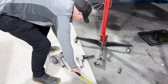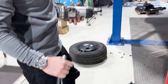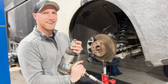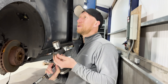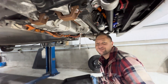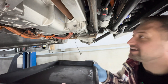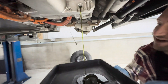I found a one-inch socket that fits and the one-inch impact gun — so this is like Guido Mark II. That made light work of it. I'm going to drain the gearbox oil so that when we remove the drive shafts it doesn't go everywhere, but I can't actually get our proper oil catch tank under it because the van's too low. Why is it green? It's a horrible green colour — like the stuff they put in the power steering on old VWs.